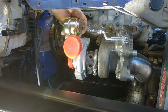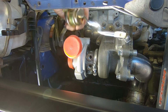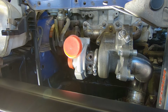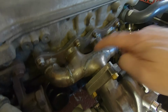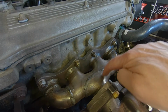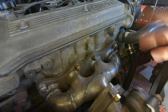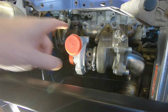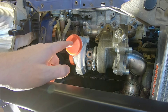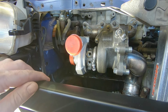I've been through it so many times now, I'm kind of sick of looking at it. So basically, we're at the point now where we're going to change. I'm not thrilled about it, but the option is we either go for an external wastegate, and obviously the external wastegate would have to be chopped in here, welded on another pipe. The external wastegate itself is about 350 quid, and that's money I just don't have to spend on this project, unfortunately. In the interest of keeping it simple, we're going to have to go back and change to a traditional route for the hot pipe. There's probably a very good reason that people do that.